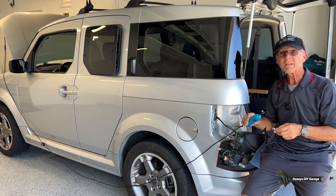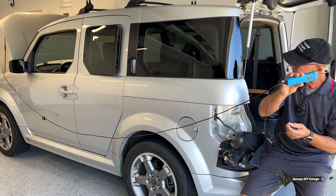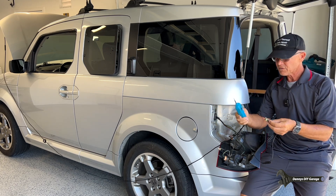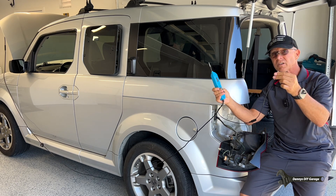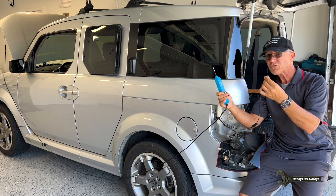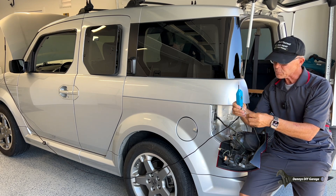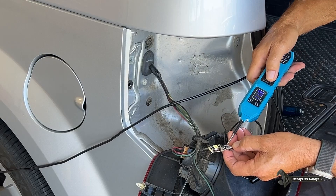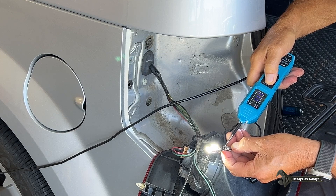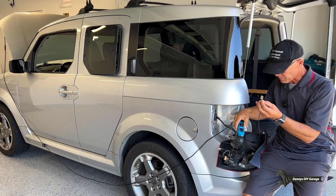So if you need to do work in the back of your vehicle — maybe your tail lights — you have plenty of cable to get you back there. I'm going to check an LED light. I'm going to use my auxiliary ground — this is just like coming off the ground side of the battery. I'll put it here, and then over here I'll supply power to this terminal. Now I know my LED light is good, so I have a problem with my wiring.